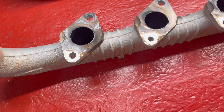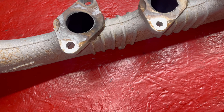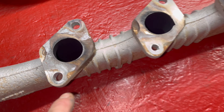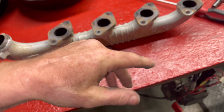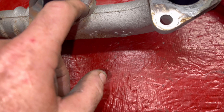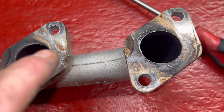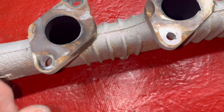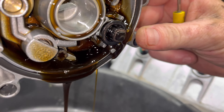All right, this is surfaced with no gaskets and I think we're not doing that anymore. A lot of them need to be surfaced, but I'm still going to put gaskets on them. I'm not happy with that — 13 thousandths from one to another when I go to surface them. But this has already been surfaced, so from now on there's no more surfacing with no gaskets. Surface and put gaskets. Manifolds, all starter out, battery cable out — oh my goodness.